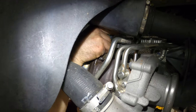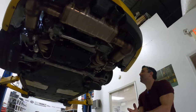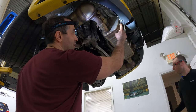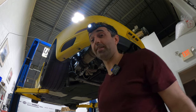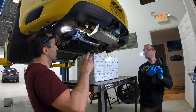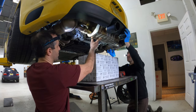While we're up here, we have to remove the exhaust clamps — you just slide them out, pull straight up; it could be a little tight. Now we're going to get the table, lower the car down a little bit, and put the exhaust onto a box or a table. There are brackets here — we're going to undo these brackets, which will allow us to drop the exhaust down. It is not being held on anything except those studs over there. Yeah, it takes a little shimmying.